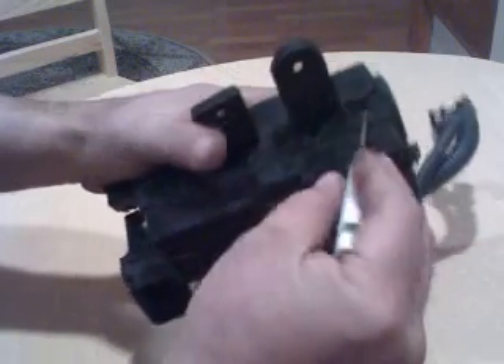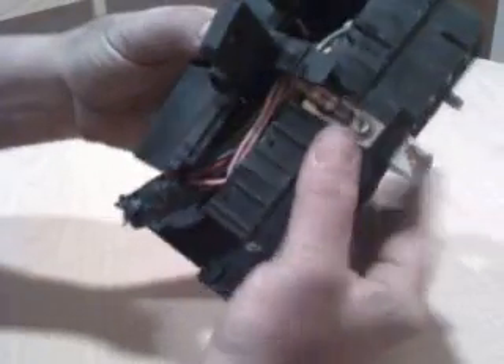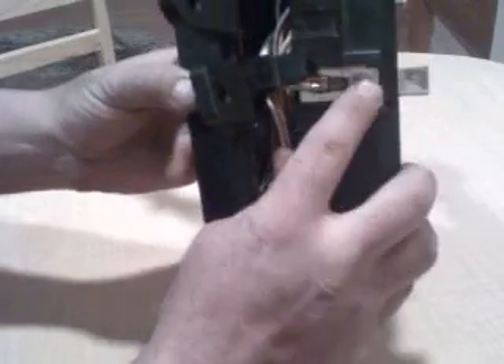There are four clips on the side of the fuse panel. Pop this down like that, pop that — it will actually take that flap out of the way so you can get to the one eight millimeter bolt for this fusible link on this side.